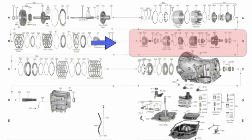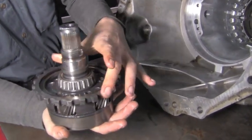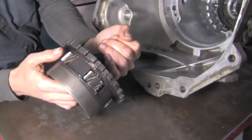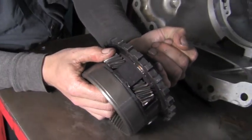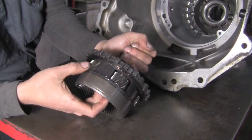In videos 11, 12, and 13 there's a lot in here — the overdrive hub, the rear planet, the front planet, the ring gear, the sun gear, and of course there's all kinds of snap rings and seals. We have the rear planetary with our parking pawl locking ring on it. We didn't have to do anything to it when it comes to sealing. We showed you earlier how to check for play in the bushings, and they have side thrust washers — there are no O-rings or seals, just all bushings and gears, no chips on the gears.